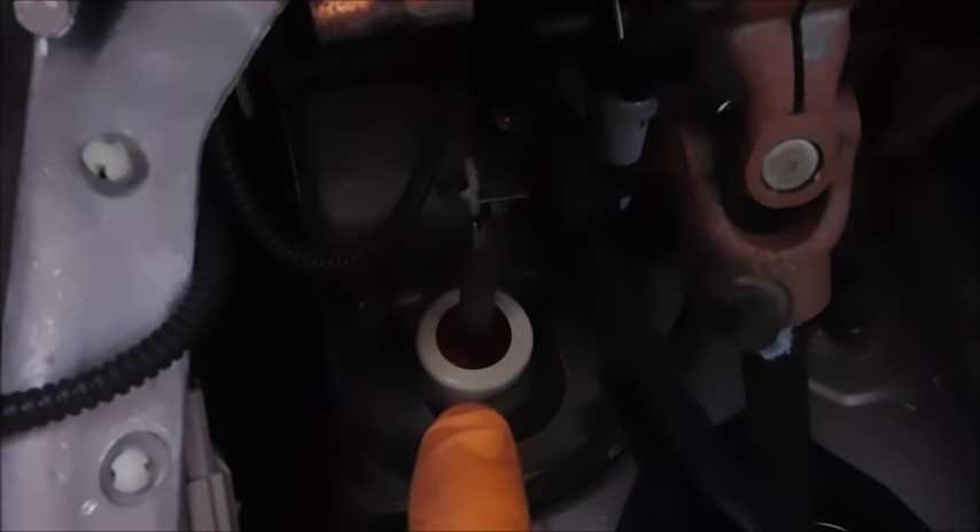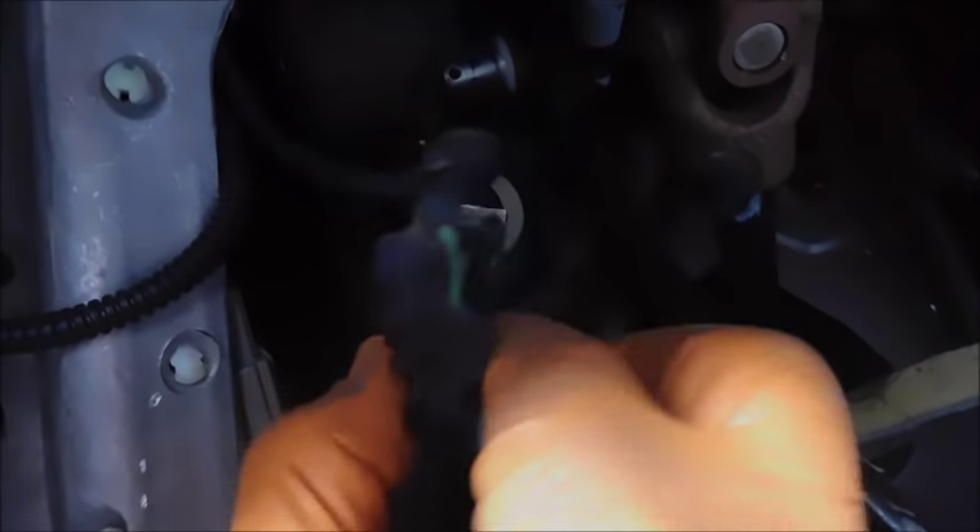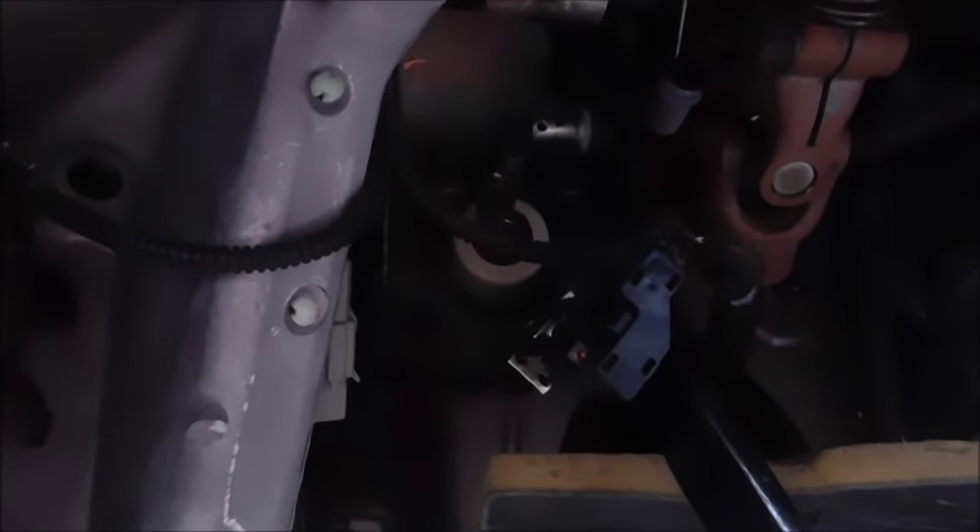It's hard to see, but there's a little clip that goes into the post that holds the arm together. I'll grab that — the little clip comes off and that allows me to slide the arm right off. With that, you've got your brake light switch, so you have to make sure that goes back on in the same sequence. There was also a washer on the outside with a slot that slips over the post while it's around the rod coming from the booster, and this sits on the outside of that.